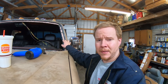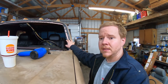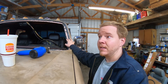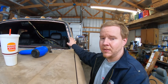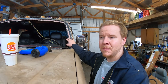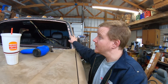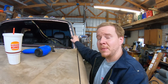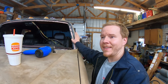We took it down to bare metal and treated the rust spots with oxalic acid. Then we cleaned it all back up, and last night we put a skim coat of body filler over the light pitting. I'm gonna take most of that back down to bare metal — basically just filling in the little dimples. After that I'm gonna clean it up again and hit it with a 2k epoxy primer, and that'll have it prepped for the windshield guys to come out and drop a new windshield in.